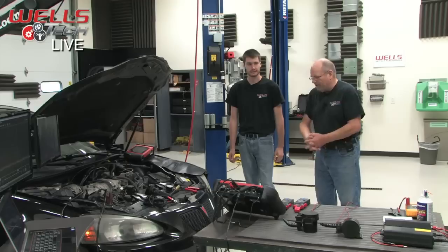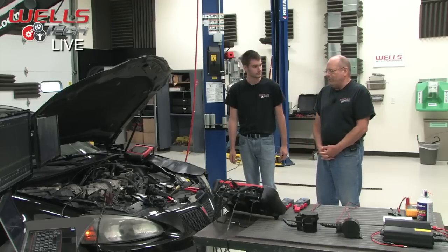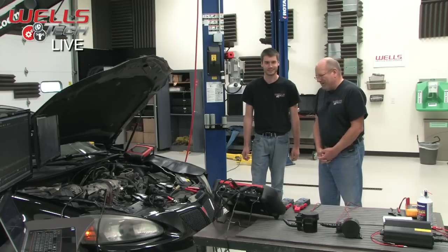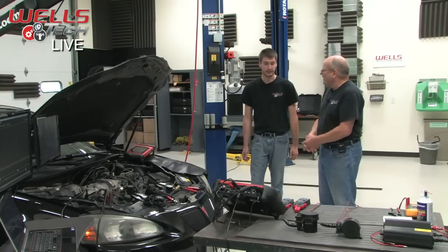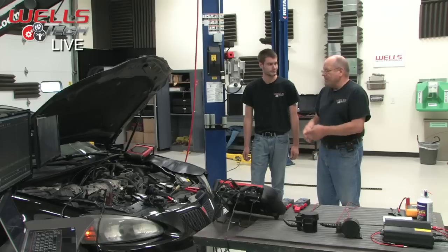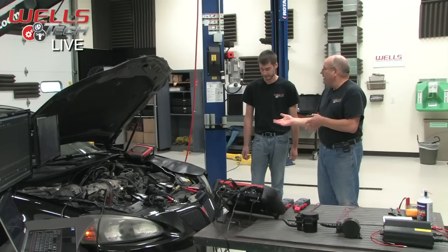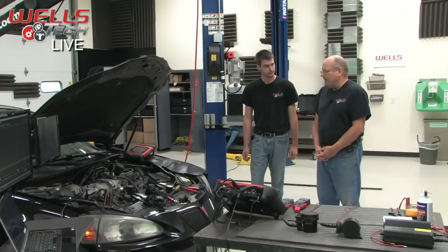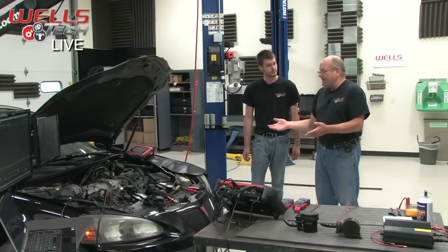Okay, and you had a problem with the P0455. Right, large leak, and you ended up replacing the vent solenoid. Yeah, that was the end result, and so far it's taken care of it. I was able to get through emissions. And this does not have the check ball in. Correct, like the diagram showed. Also, we could not find the test port for this thing.